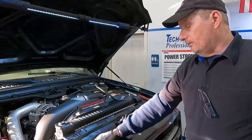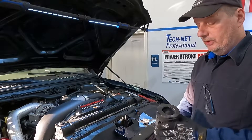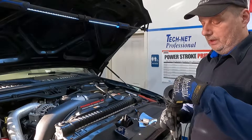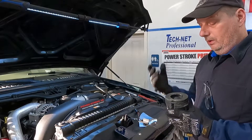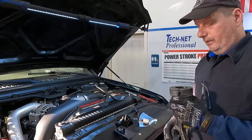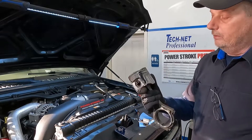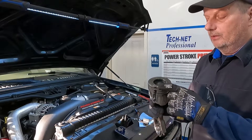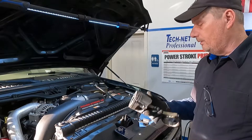The problem with sticking a camera down there is you can't really move it around very much, and the damage generally happens on the bottom. If I can't get a wide enough view to see any damage, I might have to pull the head off. They'll still run and still have a little bit of compression even when the top ring's showing like that — I've seen that a lot.